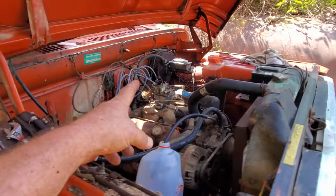Girl, she finally got us home, but I tell you what, I was beginning to wonder there for a little bit. That's weird the way that transmission was doing. Turn it off, fire it back up, and it'll keep on trucking for a little bit and then quit. It sounds like a pump issue to me. I don't know if a fluid and filter change would help, but we might do that tomorrow. I tell you what, the old thing drives good, rides good, brakes are good, it don't pull one way or the other. It's just a good old truck.